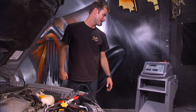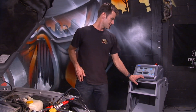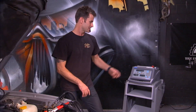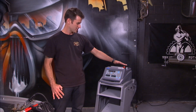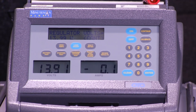All right, it's going to calculate — give it a second. And this is cool because not only can you check your charging system, you can check your battery. And what's wild is there are actually carbon plates back here — you can see it says 'caution hot' and you can feel the heat. What it's doing is running a load. Push continue because the test is complete.